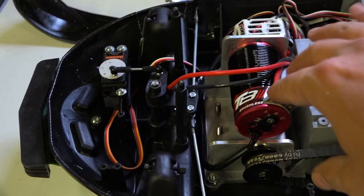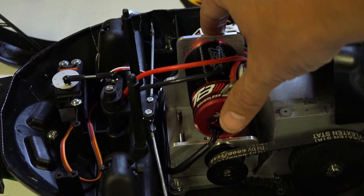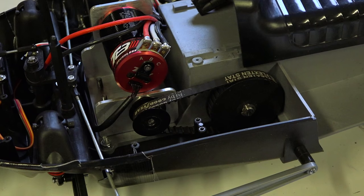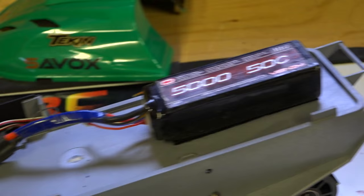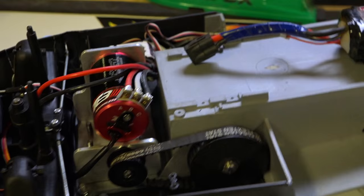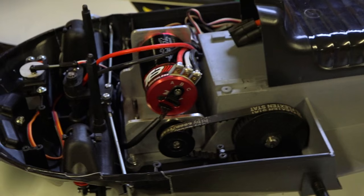I'm not too concerned about snow moving into the brushless area. It'll have to be trial and error. I did tighten up the transmission. I took a little Dremel and cut out a little bit of the body chassis — the tub chassis — and I moved this whole transmission forward about three millimeters and tightened it up. This is a Kevlar belt, so it's actually designed not to stretch, so I've got hopes with that. Underneath I do have a three-cell 50C — a pretty high discharge current — which is going to be plenty just to test out the sled. 3S is going to be ripping, especially if my Traxxas Slash rips on 3S!